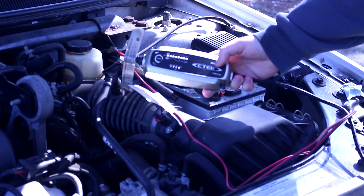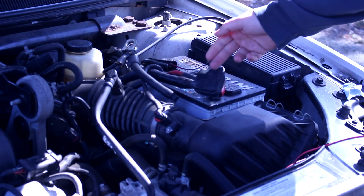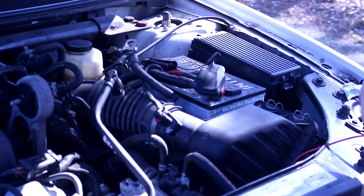It's charging, so I'll wait for that battery to charge up. Hopefully we'll see much better results with a fully charged battery at 12.6 volts. It was left on the charger overnight — it looks good. Let's disconnect this, reconnect the clamps, and see if it's happy when it starts up.